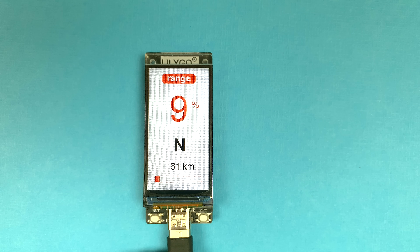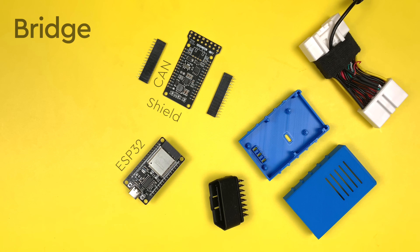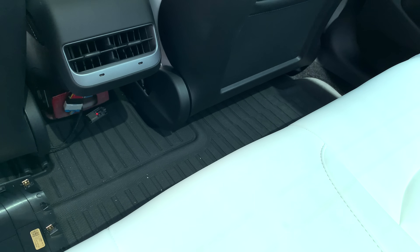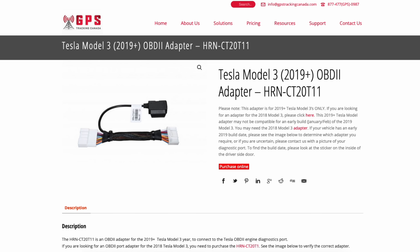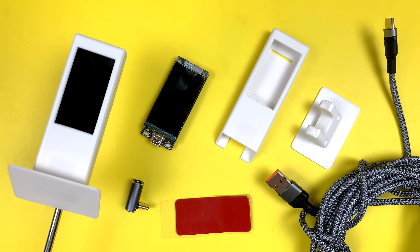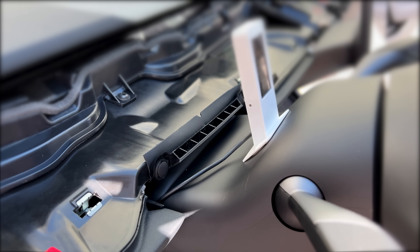And that's my screen in a nutshell — simple and small. If you are curious about this setup, there are two major components: the bridge and the screen. The bridge consists of an ESP32 dev kit, a CAN shield with an OBD2 port, and a custom 3D-printed case, all assembled together. It connects to the OBD adapter made specifically for Tesla, installed under the center console — a very popular adapter used by many accessories that taps into the CAN bus. Just pay attention because there are multiple versions depending on the car year. The screen consists of an ESP32 display from AliExpress, housed in another custom 3D-printed case, secured to the steering wheel with double-sided tape, and powered by a long USB cable that runs to the back USB port.